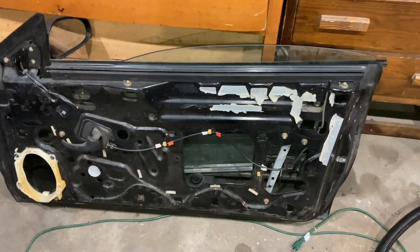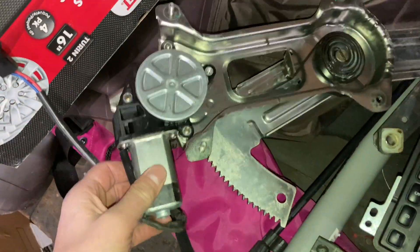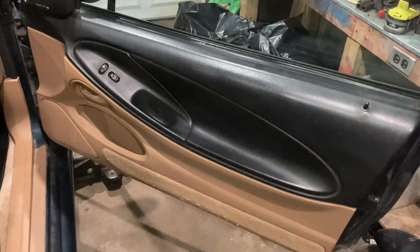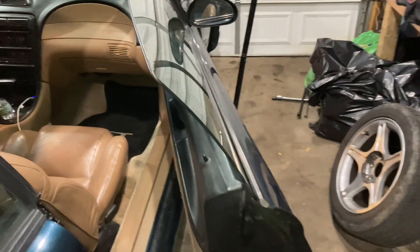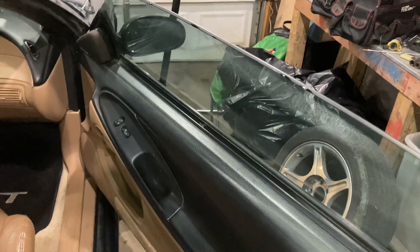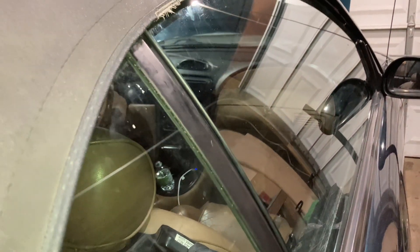As you can see, it's all braced up on the subframe. I was out here messing around the other day — I pulled the regulator out of this door here and pulled this one apart. It had a brand new regulator in it already, but I think this isn't the right one. It looked different from the factory one that was in that other door. And of course I got it all back together and it doesn't work. I think the problem is that this is aftermarket glass — someone put the wrong glass in it.